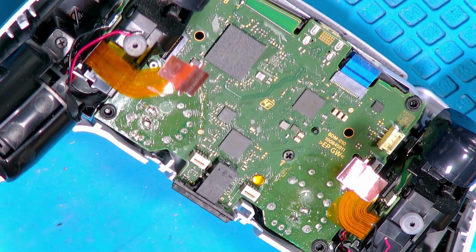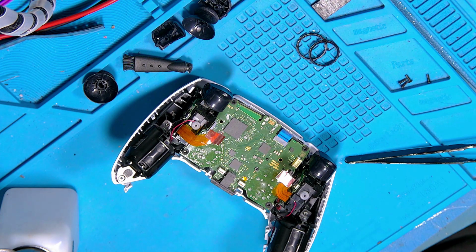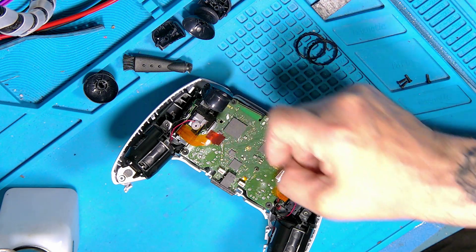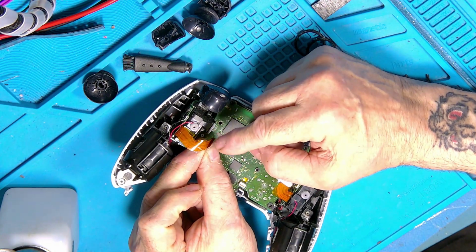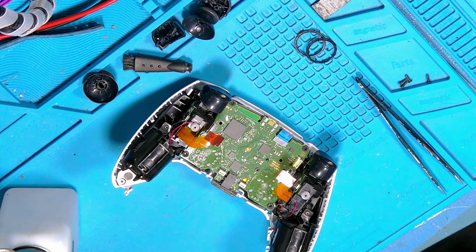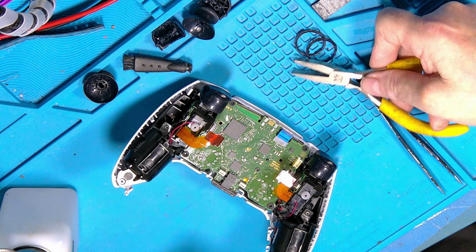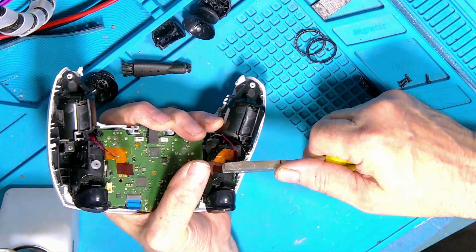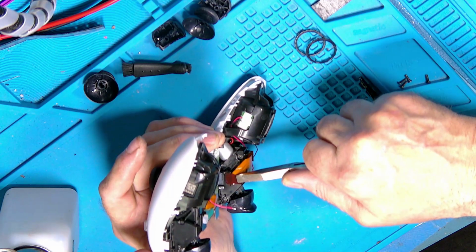I can't really show on that. On these you've got like a tag. I don't know if you can see this dark piece. It is separate. It separates from the ribbon, as you can see here. You've got like a tab. The best way to put these in is to get yourself a pair of tweezers, but tweezers are not quite strong enough. I use these grips. They've got no teeth or serrations in them at all, and it's great because you can just literally hold the back of the thick bit of whatever it is to actually pop them in.